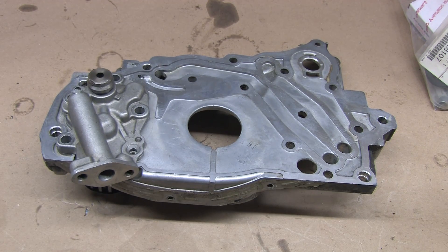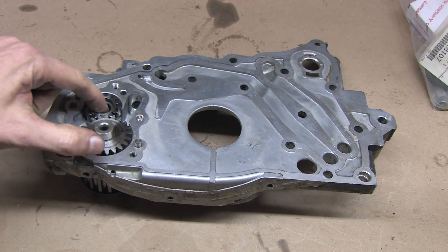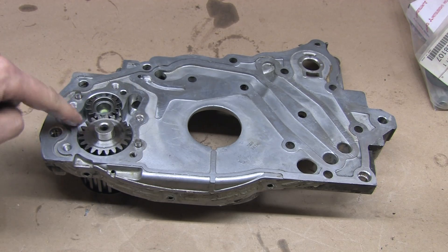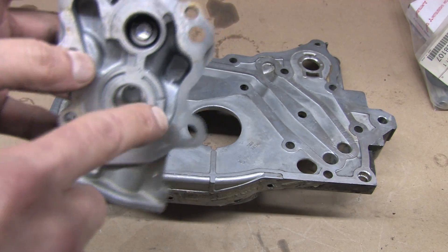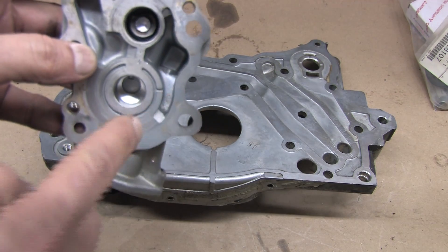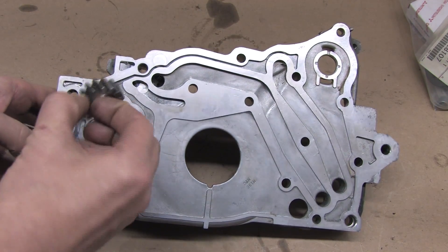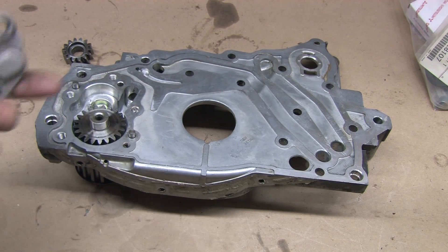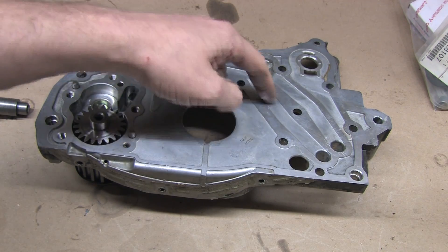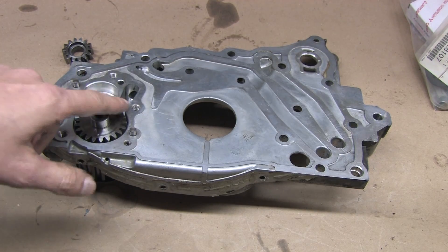This is the primary reason people replace oil pump gears on engines with high miles — as the gears wear, their oil clearances grow wider and more pressure bleeds back from the high pressure side to the low side through those gaps. Any excess oil pressure that bleeds between the pump gears and the housing while it's being pressurized gets returned to the low pressure side through a small series of galleries cast into both the front and rear oil pump housing. This prevents high oil pressure from building up on the sides of the gears and forcing them out of operating alignment, reducing friction. The oil pump's primary job is to provide oil volume, not pressure. Remember this.